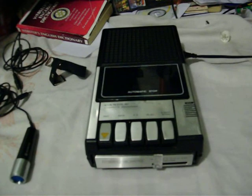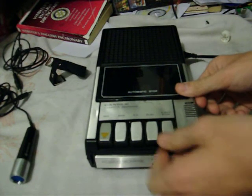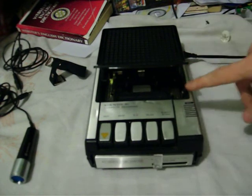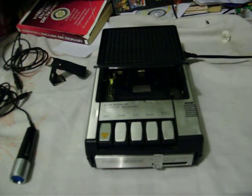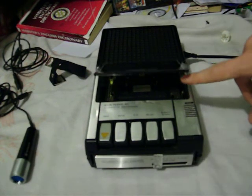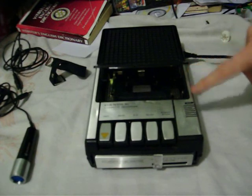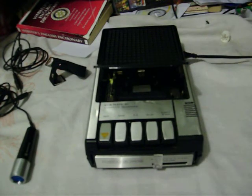It has the exact same transport mechanism and circuitry as my Rexin CT500, although this is a bit more refined. I'm going to pop in the cassette and point out the weak link, and also tell you about a manufacturing defect. Down in here there's a little tiny catch tab, and because it's made out of plastic, the catch lever has actually worn away the plastic.